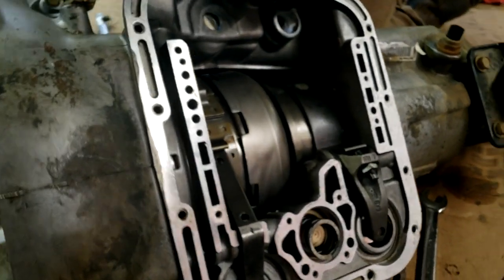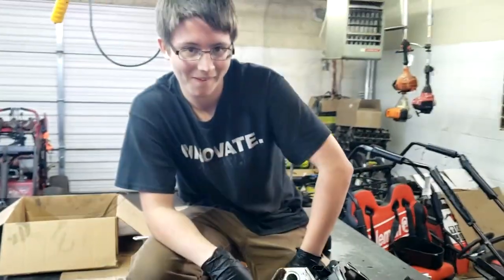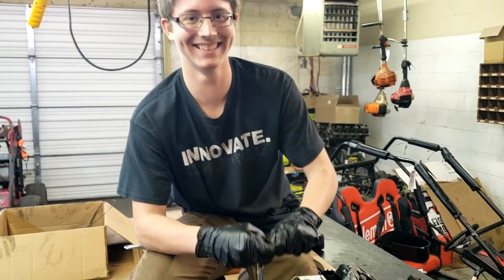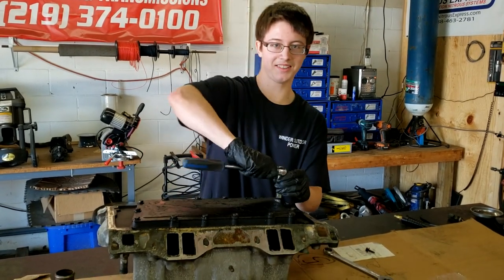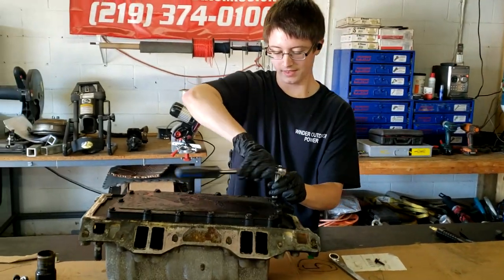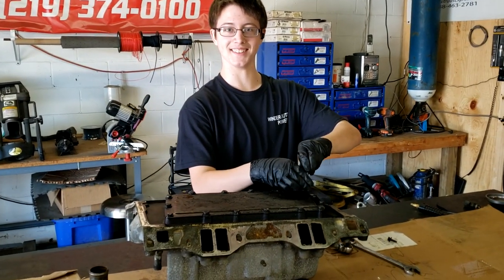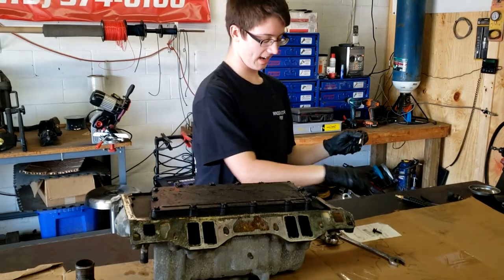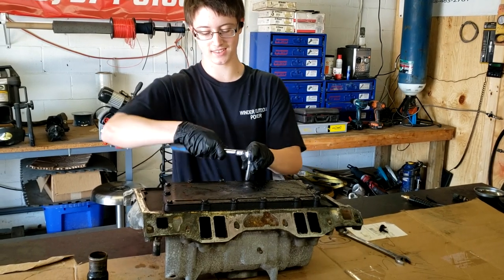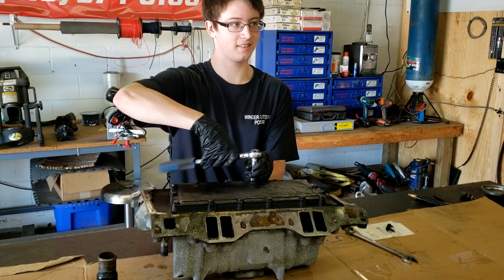But yeah, it's been a fun project guys. Hopefully it works - one way to know is if it'll do burnout. We got my boy over here pretending like he knows what he's doing on this intake manifold. What's that thing go on? The 5.9. What are we doing to it? Replacing the gasket and a little bit of porting action - replacing the little valley pan gasket.